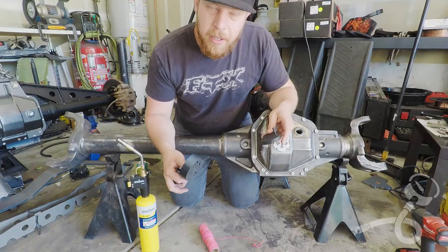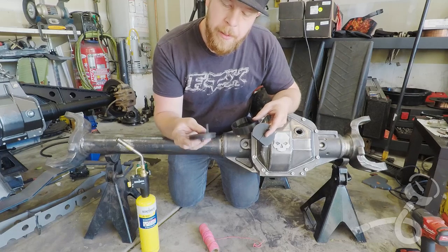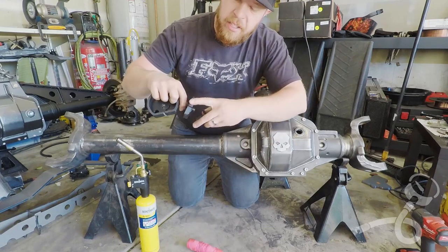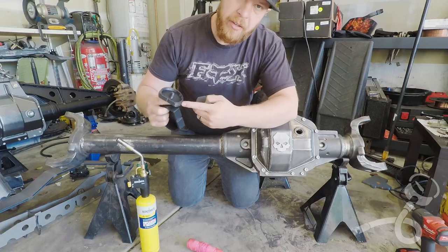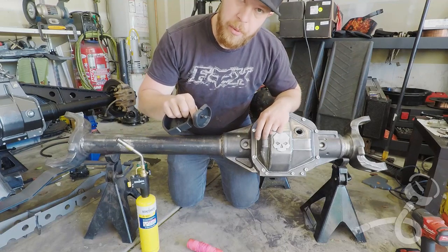Okay, what I have here in this 3D printed bundle of joy are two end caps that match with a post, and then it has a little spot where this string can come through it. And the reason why this is flat is because most 3D printers have a start stop, which will leave a bulge on a rounded edge like that. So I gave it a flat just so it could start stop in the flat. It naturally will do that on its own, the one that I use.